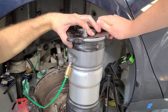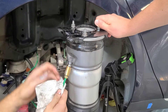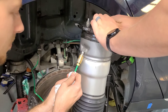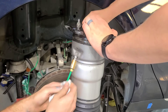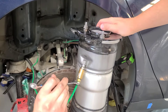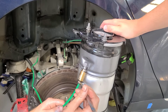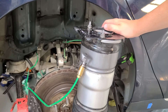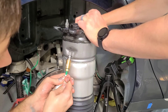We're not putting it all the way in — just before the rubber seats. Now I'm going to take a paper towel and push the line in. You see I had to push fairly hard — that's how you know you've gotten it to seat all the way to the bottom, as far as it's going to go. Go ahead and snug this down. I'm going to keep this a little bit loose just so that this can twist just a tad, because as we put this up into the car we want to get this lined in the correct position. Then we'll just give it one more little push, make sure that this is seated completely. Make sure not to kink this hose.